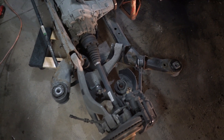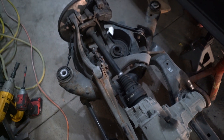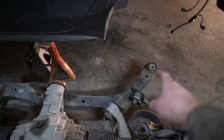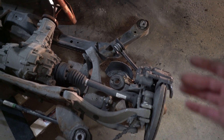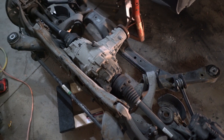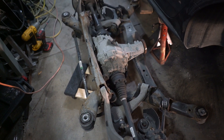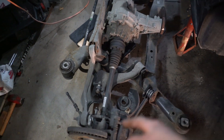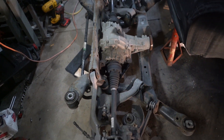There it is — got the rear subframe out. That's the sport diff in the center. Basically there are four bolts on each corner: you drop those, put a jack under each end, lower them down to release the compression on the spring, the spring pops out, and then the whole thing comes out of the car. It's really heavy — basically a hernia waiting to happen. I'm going to put the jack under this corner, get the dolly re-centered, and try to move it somewhere useful.